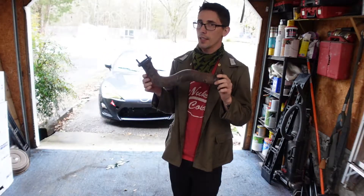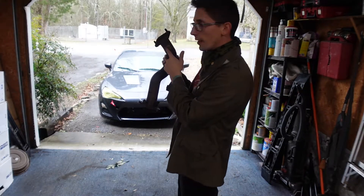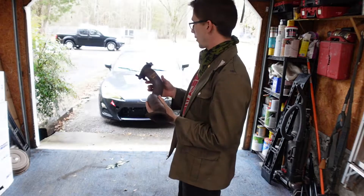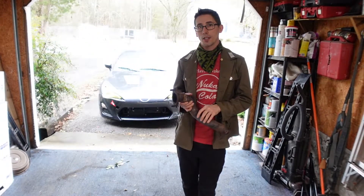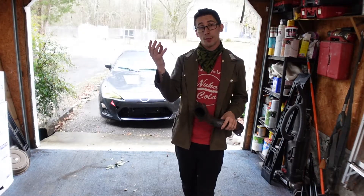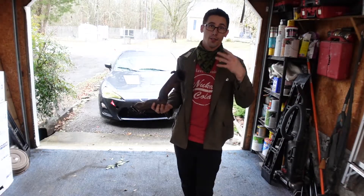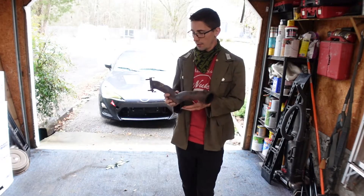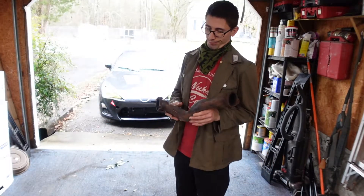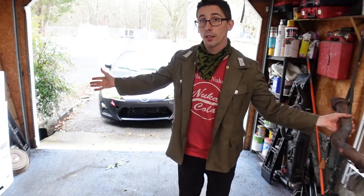You're not going to really see or feel anything unless you're doing the entire exhaust system. Because from the factory, for the most part, this piece isn't that bad. Yes, these little dents — I'm not sure why they did that — isn't helping and it's slightly restrictive, but it's not enough where you can feel it or gain horsepower. So I'd say an uppipe is one of those things that by itself I wouldn't bother with. But if you plan on doing the entire system — especially if you plan on replacing the header and having it out — yeah, go ahead and replace this, especially since you're already in there when things are hard. But if you're just doing a catback and trying to get the sound good, I wouldn't bother. Just wait until you do the entire exhaust — that's where you can get your biggest bang for your buck. Unfortunately I don't think my midpipe will be in before my first track event of the year, which is Benz Tokyo. I'll be going to NCM for Benz Tokyo this spring in March.